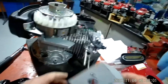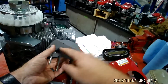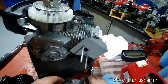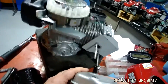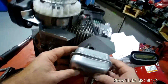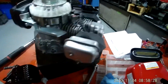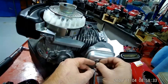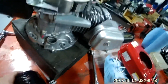let's move over to the exhaust. Here's your exhaust manifold gasket — this is going to slide on here first. This right here is an oversized gasket, and what it does is it protects the heat from hitting that spark plug and spark plug wire. The only logical way it goes on is with the hole facing out towards the front, because it wouldn't make sense to throw hot exhaust gases back against that engine. You've got these two funky looking little sealing washers — they seal your exhaust gases. We're going to put those on here.